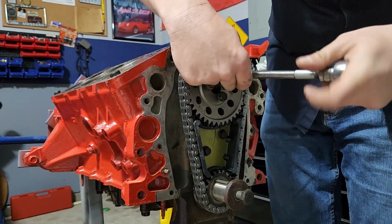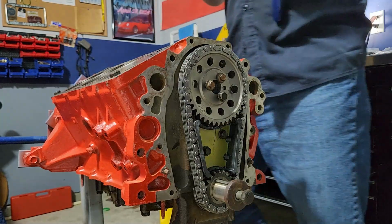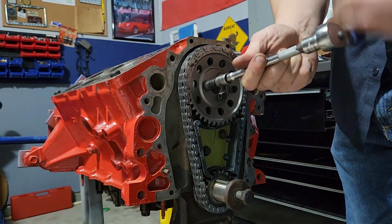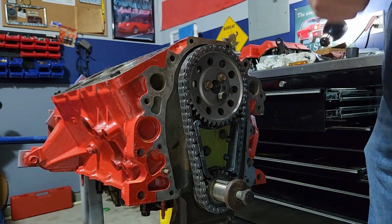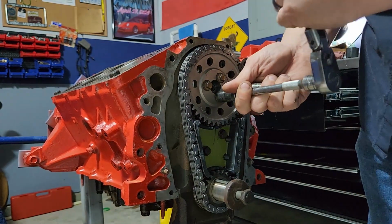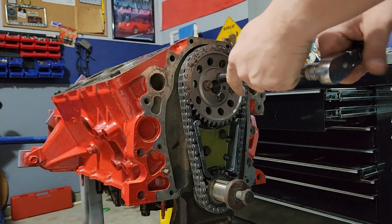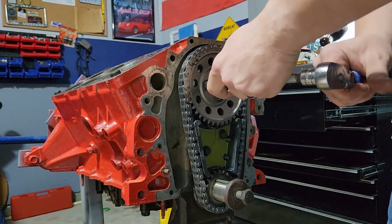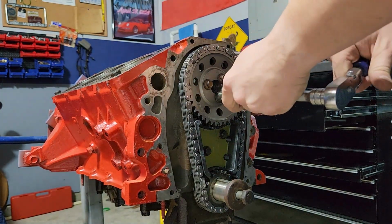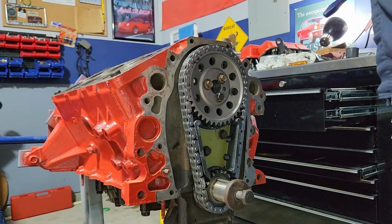There's, I'm sure, like I said, everything any engineer has ever assembled has a torque spec. I have never really torqued these. I just kind of tighten them down, make sure they're tightened down good and hard. As long as they're not going to move and you're not going to strip out your crank, it's kind of a by-feel thing. But again, if you really want to be particular, I don't know that the Haynes or Chilton manuals will actually have a torque spec for this. But if you get a hold of the actual GM service manual, I promise you it has a specific torque spec for these, because everything any engineer has ever designed has a torque spec. And don't lose your bolts like me, where you're mismatching them. I mean, we can get away with it, but try not to do it.